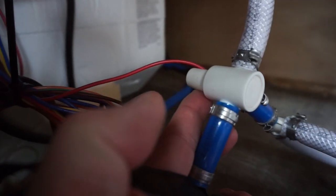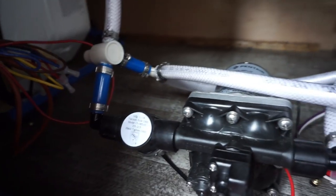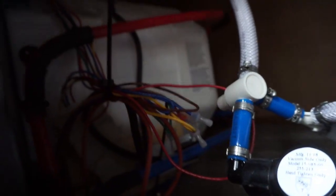The water pump's here and the hot water tank is in there. There are a couple of valves in here you need to be aware of — obviously red is hot, blue is cold. Those white valves on the back of the tank need to be turned off. When we put antifreeze through, you do not want it going into your hot water heater, and that's how you stop it. Then turn this other valve on right here, and this will draw the antifreeze from this spout, coming directly in through the pump. It'll pressurize the system, and then you go turn all your faucets on to get the antifreeze flowing.